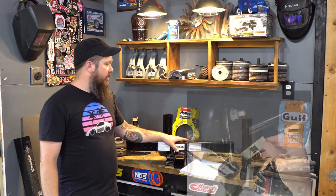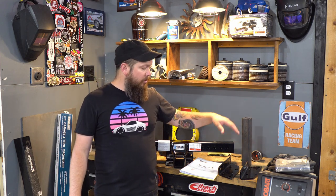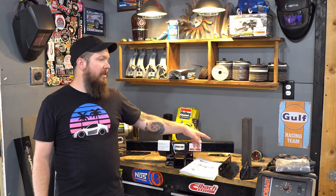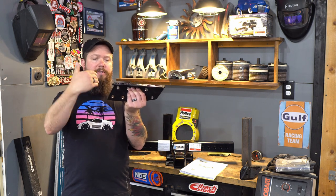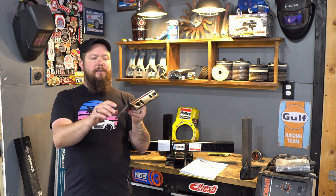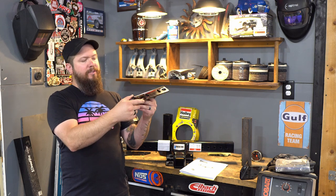And then I'm going to weld square tubing to these end pieces. So it's going to be all bolted together. These end pieces are going to slide in here. And more than likely, I'm going to weld it all solid, because what I'm going to be doing also is tying other pieces in. So say that this is the very back of the frame. This is where the bumper is back here. She's going to bolt up here, and the piece of steel gets welded on more towards the front here.